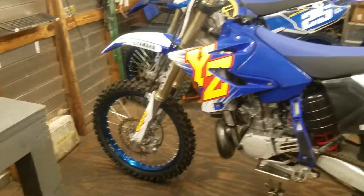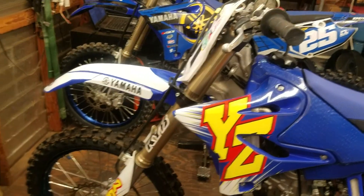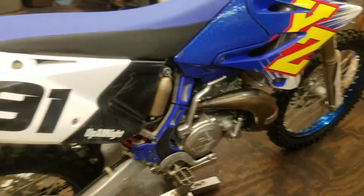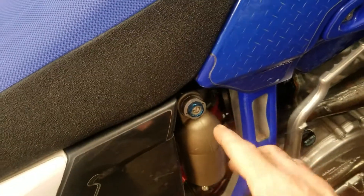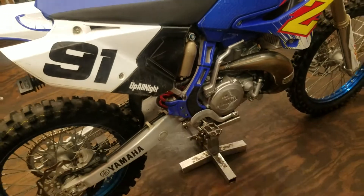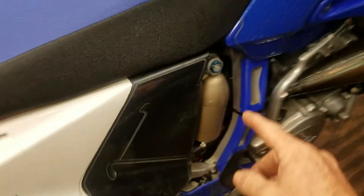By the way, I'm currently running 332 cc's, but I weigh 150 pounds in street clothes. I'm currently running 332 on each fork leg and that's working for me on this bike. If you need more bottoming resistance from the rear, you just add a little bit of height — assuming you have your spring rates correct, as in videos one and two, and you have your rebound set right, and your low speed set the best you can.